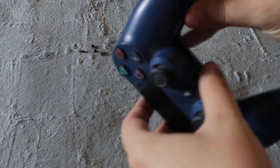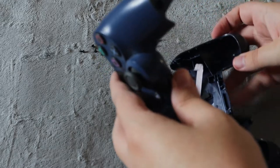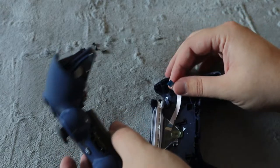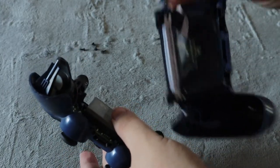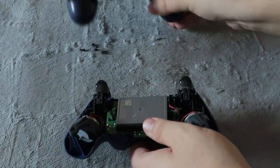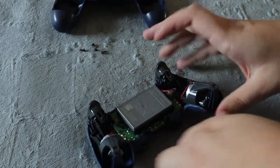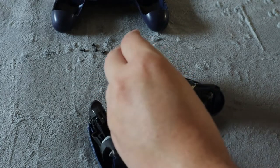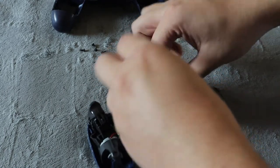You're just going to work it around just like this on the front here, starting. You will require a little bit of force, but you will have it separated just like this. Now, I accidentally already unplugged the cable here for the light bar. And here is the battery right here. So you're going to move that to the side, and all you're going to do for the battery here is literally just lift it up out of the spots. You're going to unplug it here,